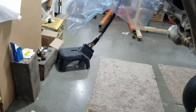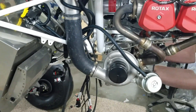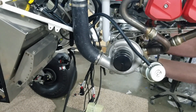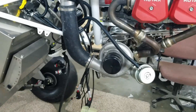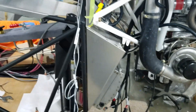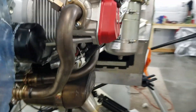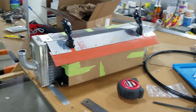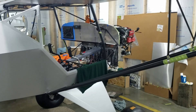That's about all we've got done this week. It doesn't look like much, but I've been all day making all these lines and hoses and stuff, which is really enjoyable. I've made hydraulic hoses on the farm - this is really the same system. These are already rated to a thousand PSI, so with 45 pounds of fuel pressure and probably 70 or 80 pounds oil pressure on a cold morning, you're well within limits. So that's about all I got today. Have a good Memorial Day weekend. Hopefully I'll get some more time out here Monday - see you next time.